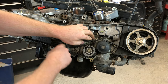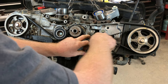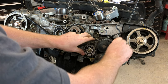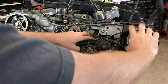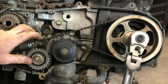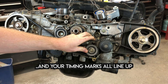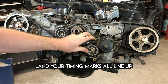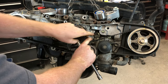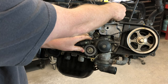Now what we need to do is get our tensioner and get this pulley in as easy as possible — it can be tricky. What we need to do is make this belt right here as loose as we possibly can, which means we're gonna need to tighten this up on both sides. That means we're gonna turn this cam just a little bit counterclockwise and tighten everything up. Now everything's tight and we've got as much play as we can get right here where there's no pulley. Doing all that together will usually help the tensioner slide in.